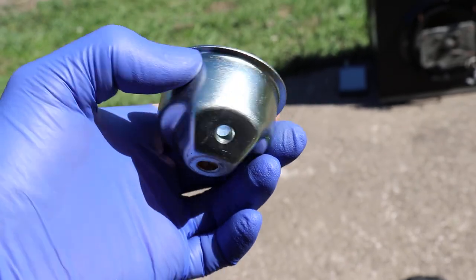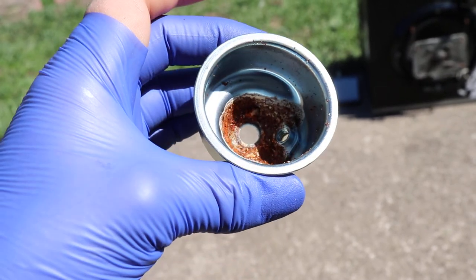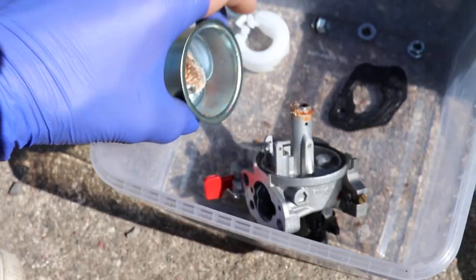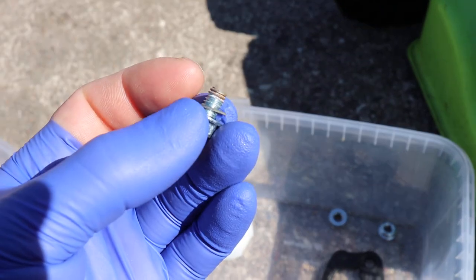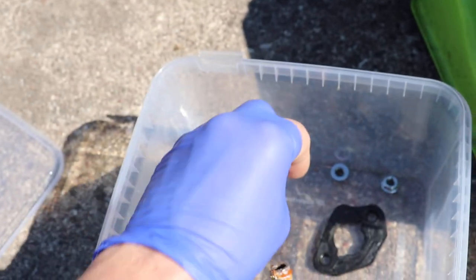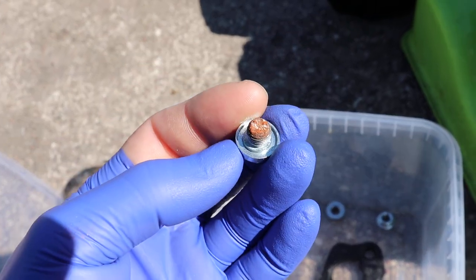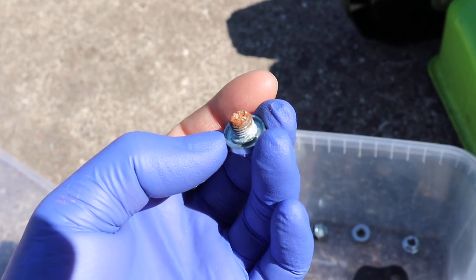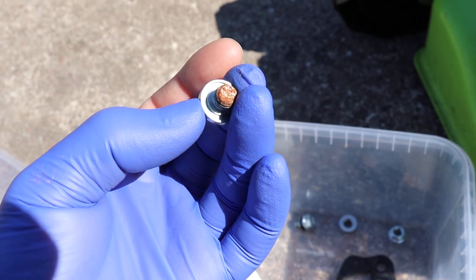This is obviously made out of steel, and it's plated with something which isn't supposed to rust, but it obviously has. And I think a major issue beyond that is the screws they've used to screw the thing together — also plated steel, but the platings are so poor quality and they've been rusting. There must have been a slight amount of water in the petrol gathered in the bowl of the carb when I put it away for winter, and that just corroded everything to hell.